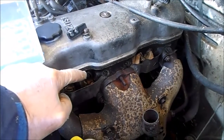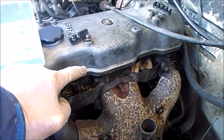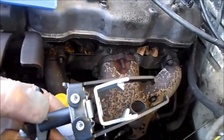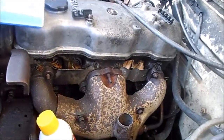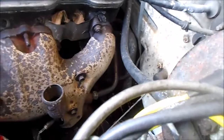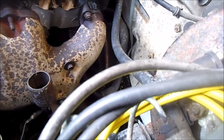So I figured I'm going to have to put a new valve in this and probably do a valve job on it. I bought my valve compressor over at Harbor Freight the other day for 10 bucks or something like that. I was going to try and pull this EGR thing off, and man, it is way on there — it's not coming off this side.